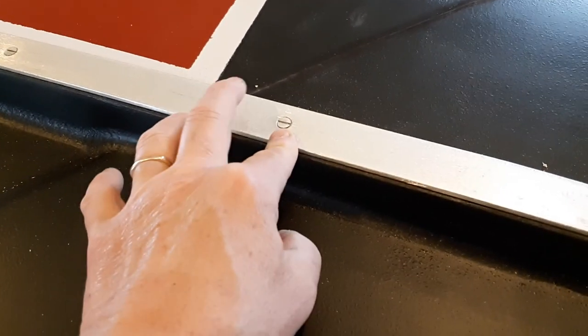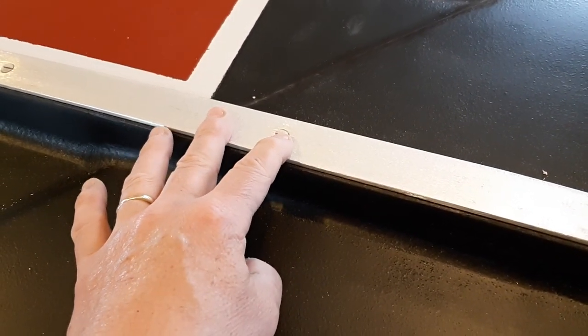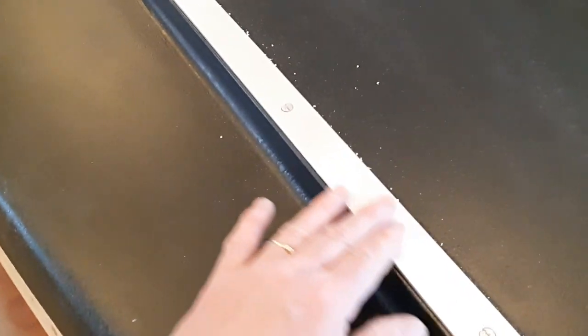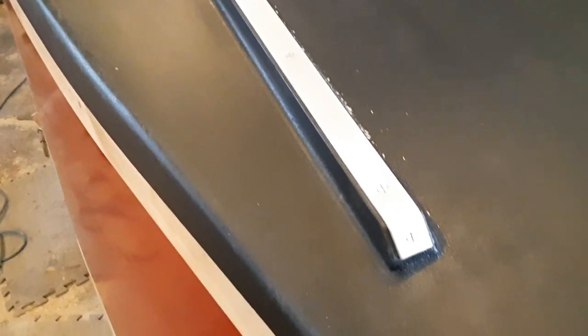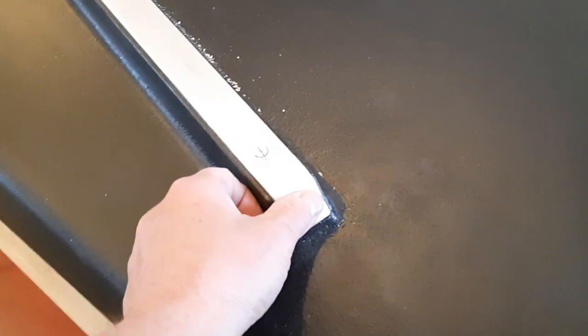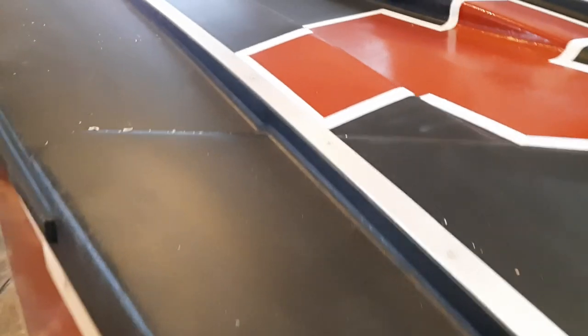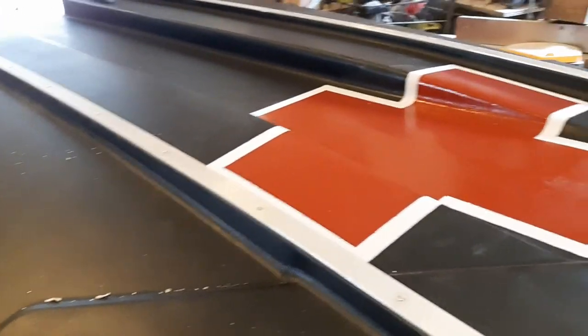I had 1-inch aluminum screws. I drilled out the holes generously, so just the thread catches, because I didn't want to snap the screw. And I filled the hole with the Sikaflex, and bedded those screws in. The whole thing's glued. The Sikaflex will handle that all on its own. So really they're just to hold it down till the Sikaflex cures. Especially a single screw here at the point so that nothing gets under here. I might put a little bead of Sikaflex right on the very leading edge, just so no weeds or fishing line or whatever else hooks it.